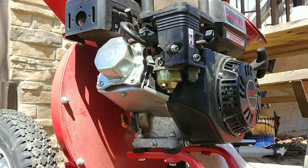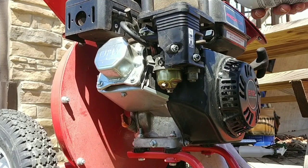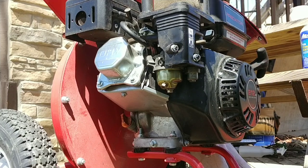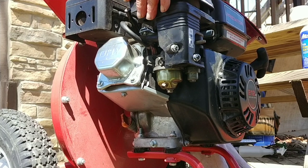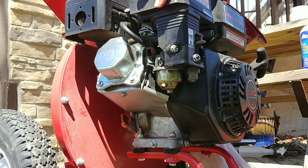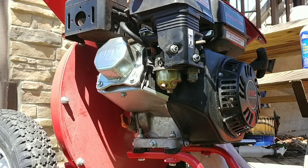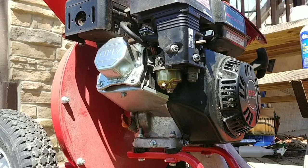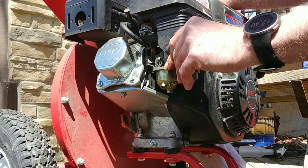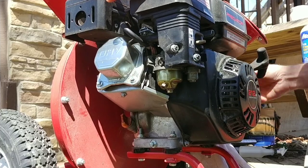And then, normally I would use some starting fluid. I've got a little bit, but I lost this stupid spray thing off the end of it. I'm gonna try it. So I just got some premium starting fluid. I'm gonna try to get some to spray in there. Oh, it is gonna spray. There's some starting fluid. Put this lid on it. Starting fluid is really just to help me get the carburetor primed. Because it's a free flow system, but the fuel bowl was empty because, let's see, this has got to be on. This over here has got to be on.